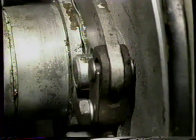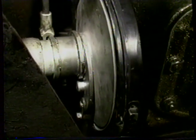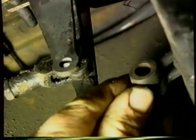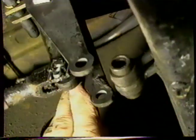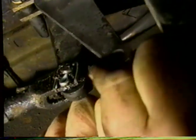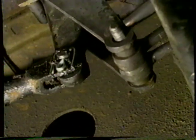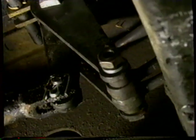So we put our rod in to our servo arm. We put the clevis pin through, the horseshoe clip on, and secured it with the bolt. Now we're going to rotate it back so that we can put the bolt in the master cylinder actuating lever. So we're going to put the bushing into the two rods, like so. We're going to put the two spacers on either side. We're going to bring the rod forwards. Then we're going to pass our bolt through, and we're going to put a washer and a nut on the bolt, and we'll tighten that up.